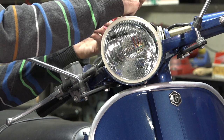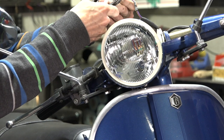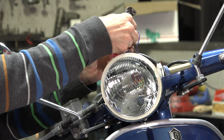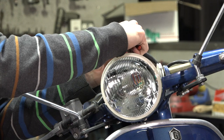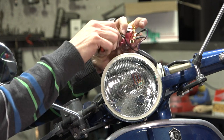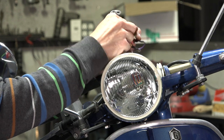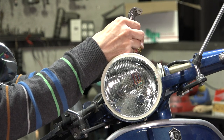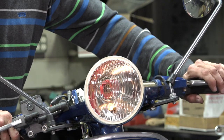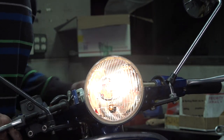Reconnecting the wiring - the high beam connections are a little loose; you may need to crimp the quick connectors so they actually grab onto the terminal. The ground terminals are shared between the two - that'll be your black wire. Every single headlight can be a little different; you can use trial and error and you're not going to damage anything if it's wrong, it just won't work. Last connection is the city light. Doing a test - city light is coming on, high beam and low beam look good. I'll check it out at night on a test ride.